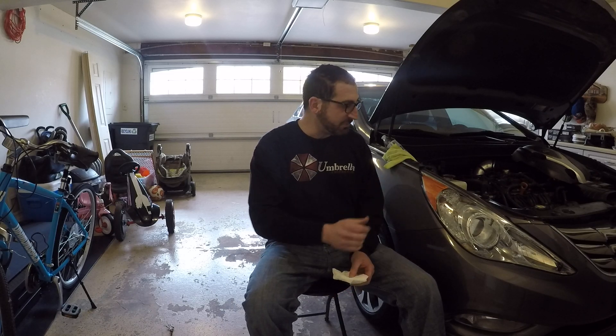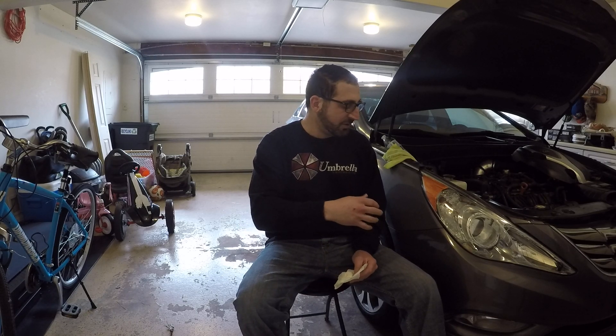It's been working really fantastic. I was stunned by what this catch can really picks up — before it gets into the intake manifold, all the water, oil, soot, and residues get caught in here. I'm now a big believer in oil catch cans, especially for a GDI engine.